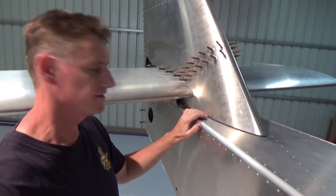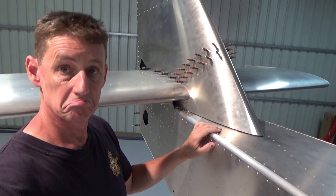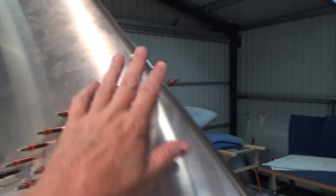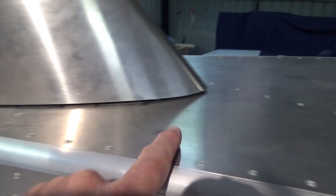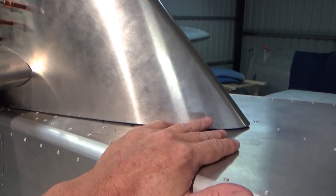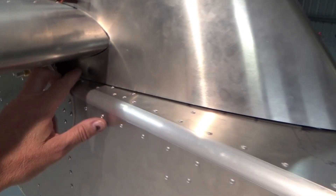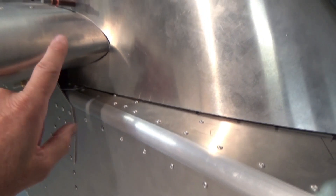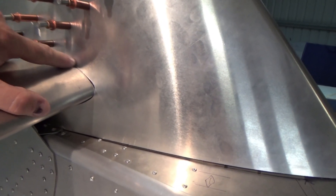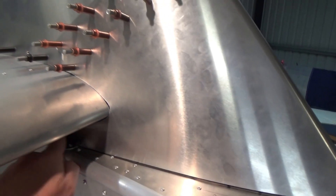One dorsal fin installed — that's the initial fit. Not bad; pretty happy with that. It's a little too tight though — I've got to put some relief in there. So the dorsal fin: A4s at the top, A5s at the bottom. Those templates worked really well, though it's a little bit higgledy-piggledy. I've got about an eighth of an inch around the bottom; the L angle's in there but there's nothing at the front. So there are a few options: make a fibreglass shroud, or do nothing. I still need to clean this up because this part in there will move, and the last thing I want is a hole in my horizontal stab or chafing. So now I'll run a marker around there to give me a perfect radius and relief.